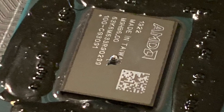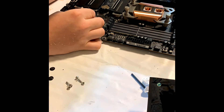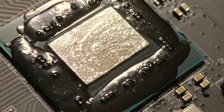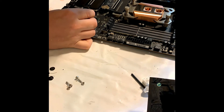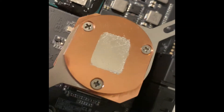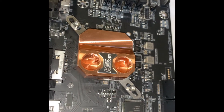You should only need about this much liquid metal — you do not need a lot. If it starts to form a pasty silvery coating on the die, just keep pressing with your applicator until the surface starts to look chrome. If it doesn't start to look chrome and just stays with that pasty consistency, apply just the slightest bit more and it'll be enough. Once you're done applying the liquid metal to the die, use the leftover liquid metal on your applicator to apply a coating onto the cooling surface as well. It should be shiny chrome, just like you're seeing. Now you have a liquid metal chipset.